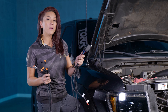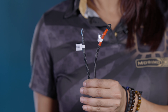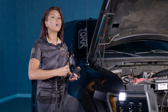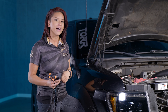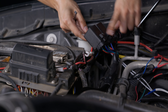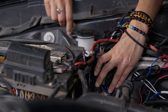Now it's time for the wiring harness. The 4-Banger harness comes with two relays, six connectors, a power and ground, and also a signal switch. When mounting your relay, make sure it is vertical so no water intrudes inside the relay. Locate the hole around the back side of the battery, take a zip tie, feed it through the relay bracket, and tighten it down.